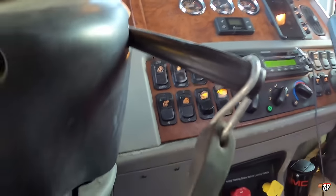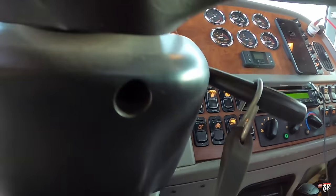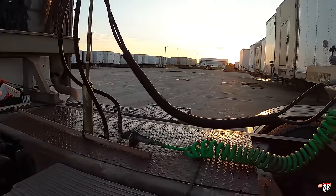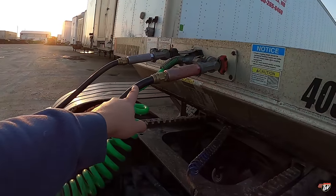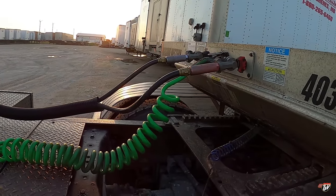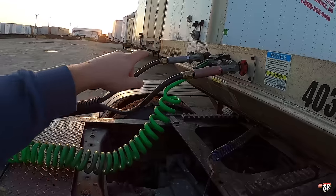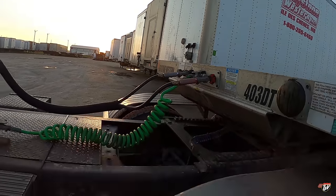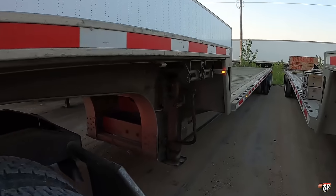Okay, we're hooked up to an empty step deck. We're going to do our pre-trip on it and make sure everything's good to go. What I've done here is I've just attached a little tarp strap from there to here, just hooked it in. I turned on all the lights, the hazards. The reason I put that strap on there is to check both lines here — so we have the emergency line open, the trailer brakes have been released, so we have air flowing through here. We want to make sure there's no air coming out of that joint right there. Those o-rings — when you pull down the trailer brakes like I have with that strap there, the air flows through this blue one. You want to make sure there's no air leaking out there as well. So we're good — there's air flowing through both of those right now.